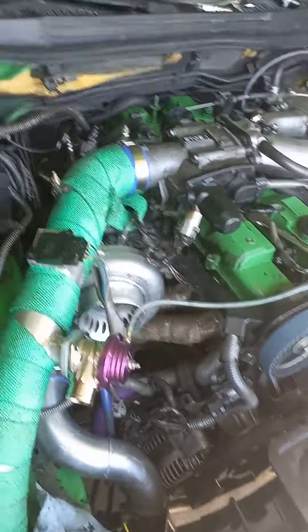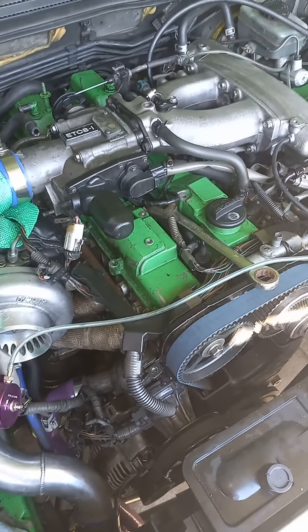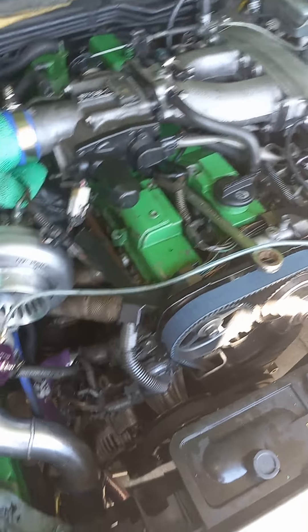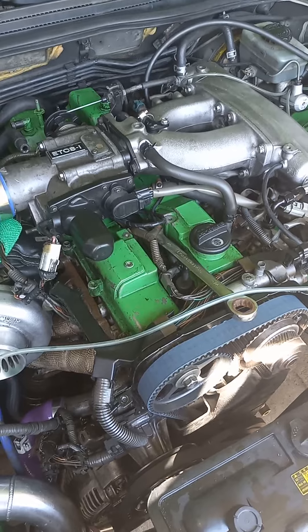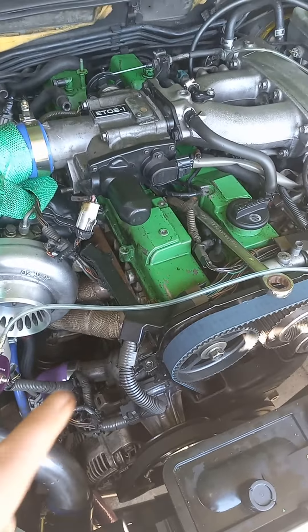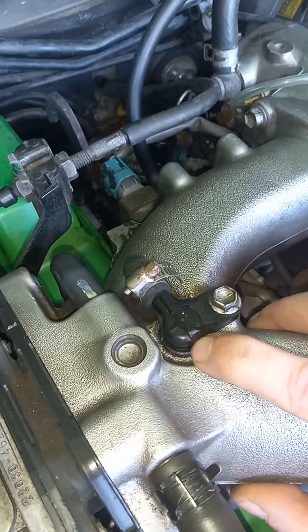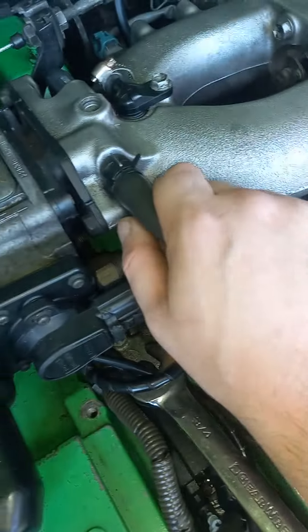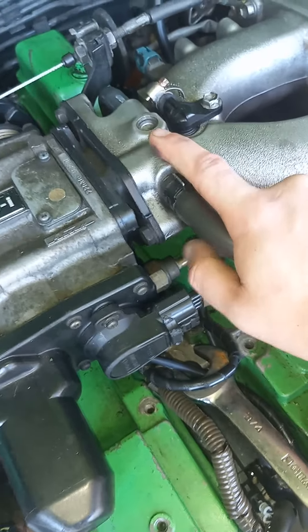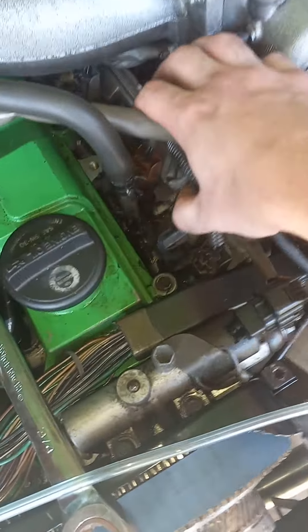The goal is the engine's coming out tonight. I'm gonna put in a new crank, new bearings, and new rods — I'll plastigauge everything and then reassemble. Got a new oil pump too. New rings, so we're gonna re-gap the rings on the pistons. Then I'm going down to a single-layer OEM-style gasket over the 1.8mm Tomei gasket I have. I'm gonna take some JB Weld and fill a couple of ports on the intake so I don't need vacuum caps on them and so boost doesn't get sent down to the fuel rail.